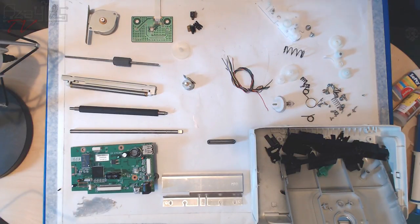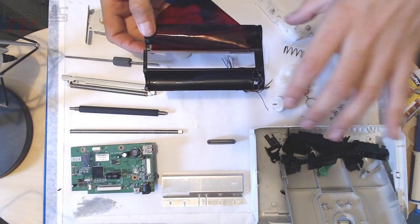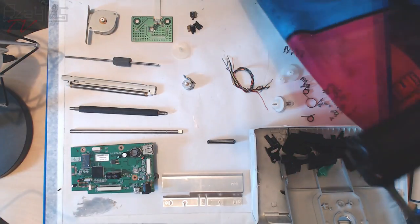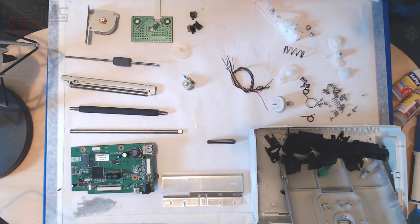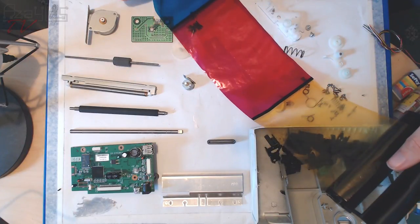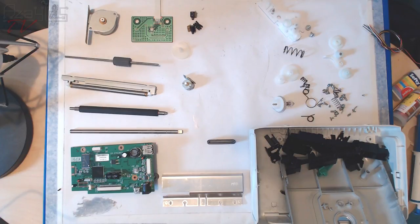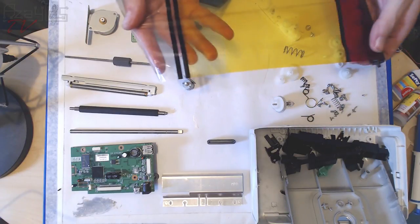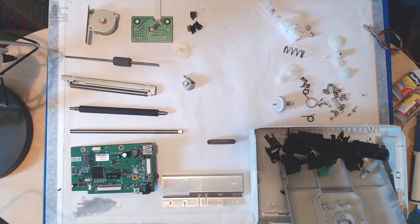Actually, I forgot about this — the roller cartridge. I thought it was a laminator but it's actually a three-colour printing process. I've got cyan, magenta and yellow. Have a look at this — you can just about make out images on here. As I pull it off I've got yellow, cyan, magenta — then a clear section. It looks like a heat-transfer method: as it heats up it takes the ink from these ribbons and puts it onto the paper.